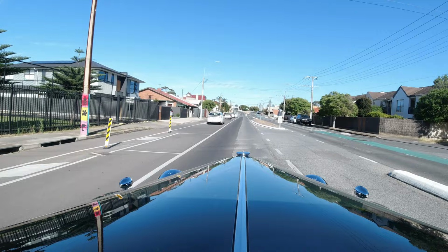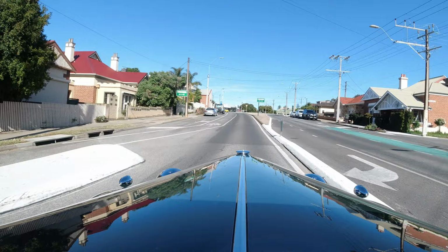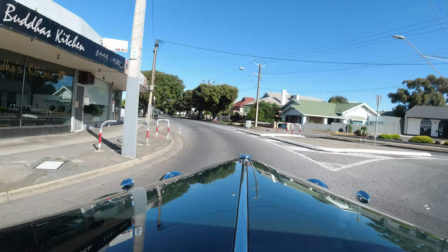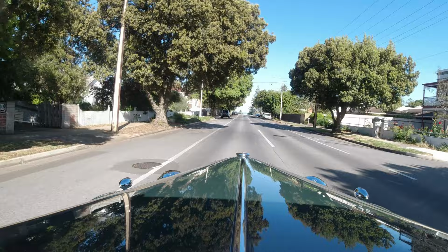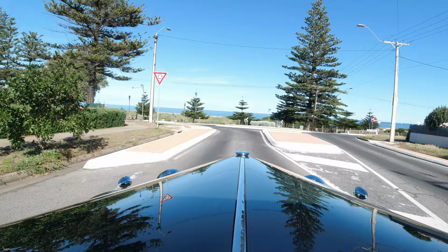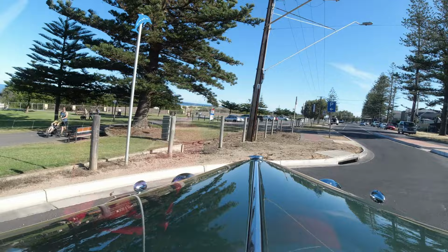We're just heading towards the coast now, just for a short coastal run. In this sort of situation, I'm tending only to change down to third rather than second, because the engine's actually pretty torquey and it seems to cope with that pretty well. Also, I'm not very good at changing down from third to second yet, because there's no synchro. I'm slowly getting the hang of it though.